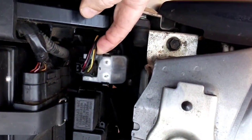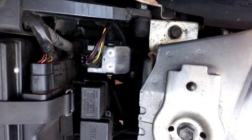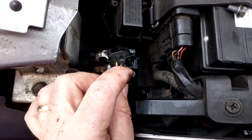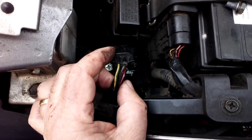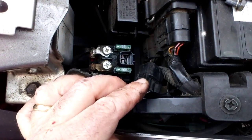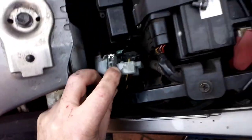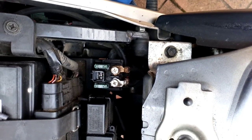There's just a plastic cover to keep the moisture out — two clips — and it looks like a four-pin connector. Before we start, we're going to disconnect the battery. To remove the four-pin connector, you just squeeze this tab and ease it off. It was a bit stiff but it came away like that.